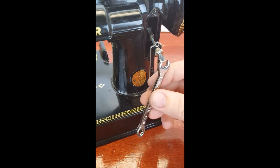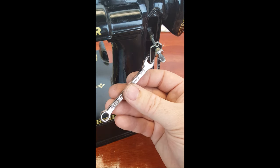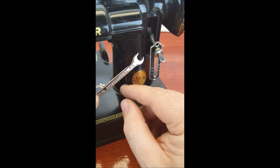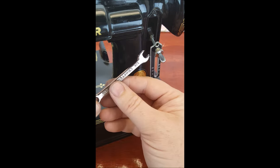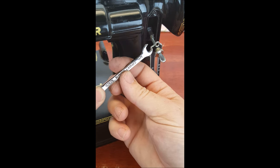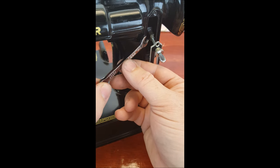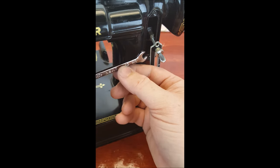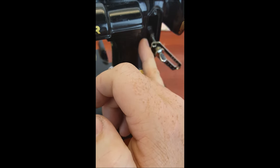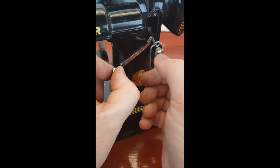Now that's a quarter-inch nut; however, most of your common wrenches from the hardware store are going to be too big to get in there, even if it's a quarter inch — the whole width of the wrench itself is too wide. They do make little mini wrenches, and that's what you need. In a pinch you could use needle nose pliers, but you'd want to put some painter's tape on the edge of your machine to protect the finish.